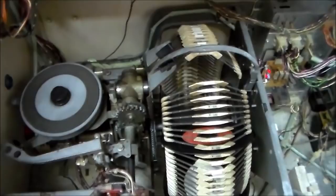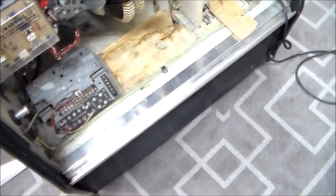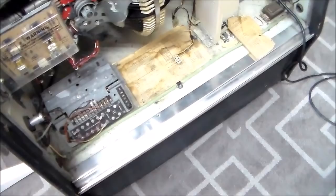We bought a bunch of arcade games off a guy one time where he had about a dozen arcade games, and he'd gone around and taken the monitors out of all 12 of them and laid them on the floor in front of the game. The reason he did that was because he was going to do 12 cap kits, you know, to make all 12 monitors look nice. And that's a good idea, but it just doesn't work very well that way. If you're going to work on something, work on just that thing until you get it done, put it back together, and then you can move on to the next thing.